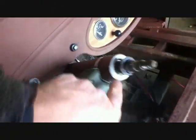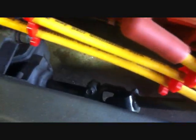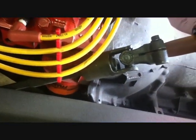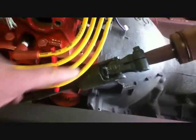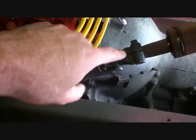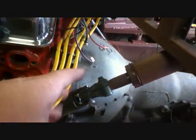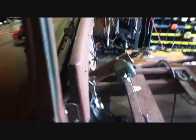The steering shaft is in. This little bushing is actually factory — my dad machined it down so it fit tight inside the two-inch stainless tube. The Jeep Laredo steering shaft is in and it's all tight. Nineteen splines on the shaft with the eleven-millimeter bolt in it. It's weird — this was late eighties, early nineties — they had some weird stuff. I think it's a 3/8-16 bolt or 5/16-18 with an eleven-millimeter head. This shaft actually extends out; it could extend up further if I needed to. I don't know exactly how far it's going to stick out of the dash, but that looks pretty damn good.